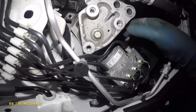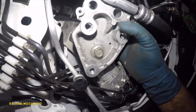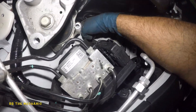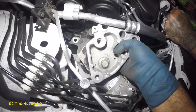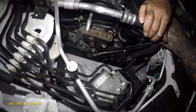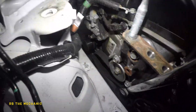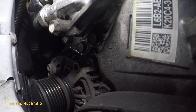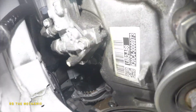Everything is disturbing everything. What we need to do is take off my wrench here — I should have figured that out first. I'm gonna push that with the pry bar — just hold that out of the way — and I'm gonna try to yank this. Crazy design, but there you go — we got a whole lot of space. Now I'm working on the alternator. The bolts are all the way down here — this is where the bolts are right there on the alternator. At least you can pull the engine forward and get the alternator out. I took off both bolts from right here.